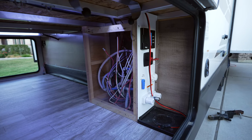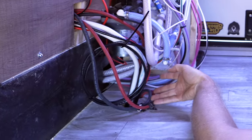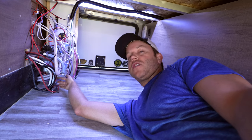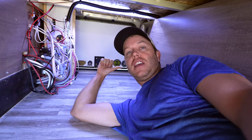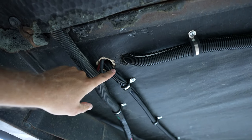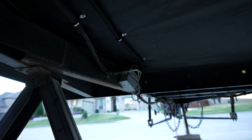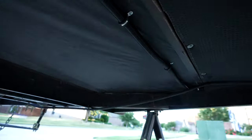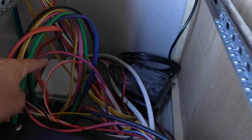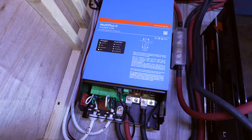Over here is the water bay — we removed the storage area and I'll have to build that back today, but this is the whole access to the cargo where we ran all the wires. Down here is where we drilled two one-and-a-half-inch holes and ran the 110-volt wire for the shore power and also where we ran the DC-to-DC charger going to the front of the camper. I used wire loom to protect the cables from the DC-to-DC charger and the 12-volt going to the chassis. That wire right there is the 110-volt 10-3 flex core that goes back to the 30-amp shore power, straight from the shore power all the way to the MultiPlus, then back like I talked about earlier.